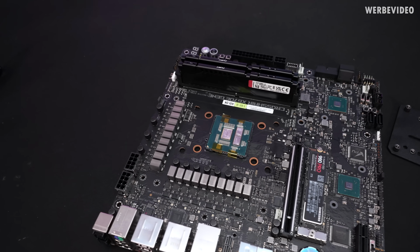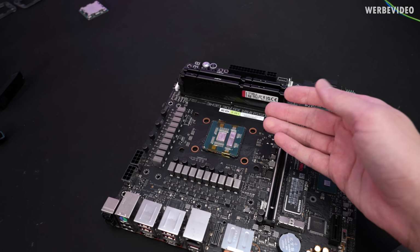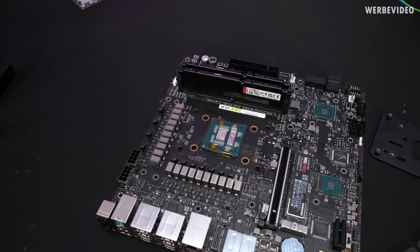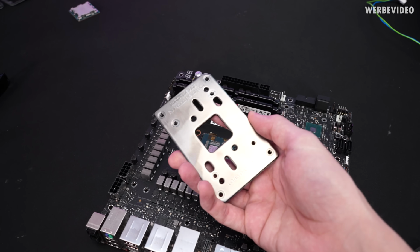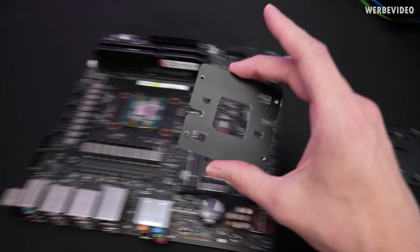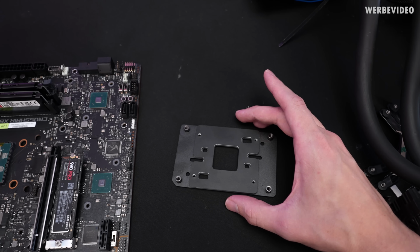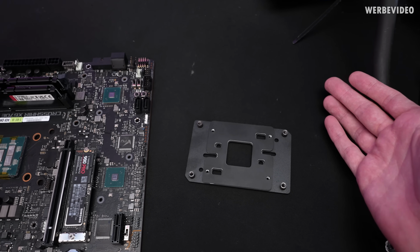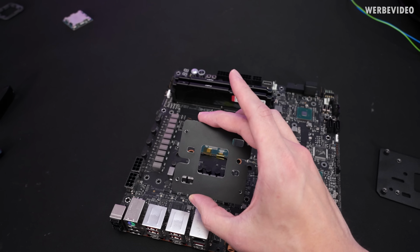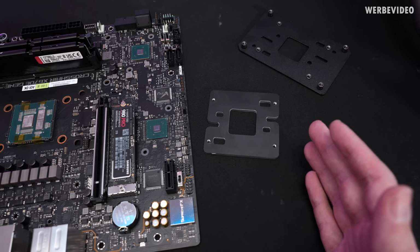But going back to my case, the direct die mount. I could not mount the CPU block from Corsair simply because the die is now sitting so much lower than previously with the original IHS. So I couldn't use the original backplate anymore. Decided to make my own one. That's made out of anodized aluminum, and it's basically following AMD spec, and it's just shorter. So I call it the AM5 short backplate. Very creative, I know. But this should allow compatibility to other coolers, maybe also to the EKL cooler, not quite sure, but also for extreme overclocking if you want to use your liquid nitrogen container.